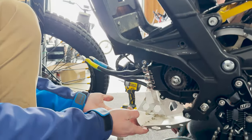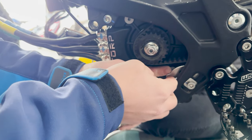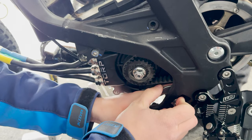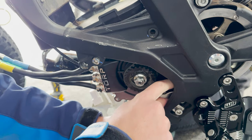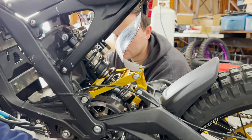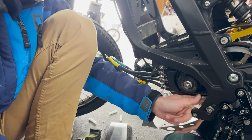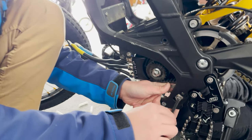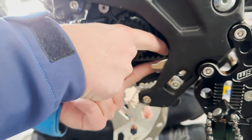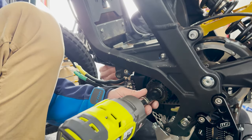Time to tighten the belt. We'll hold the skid plate out of the way, use the spacer to get the belt real tight, then tighten the bottom bolts followed by the top bolts. We just got the motor tightened down. You do not want your belt crazy tight — you want it to be able to move at least a little bit. Whatever you do, do not forget to tighten your motor bolt. Remember, it's reverse threaded, so go backwards.